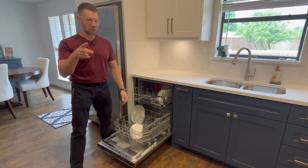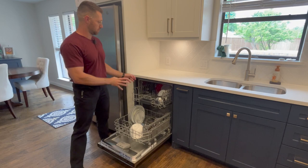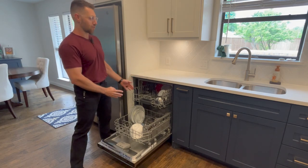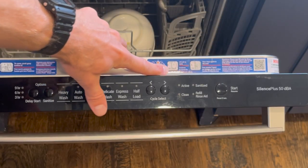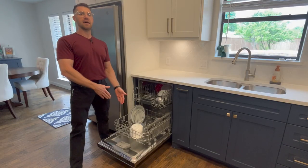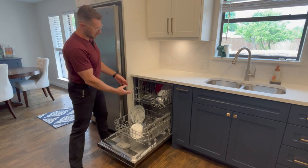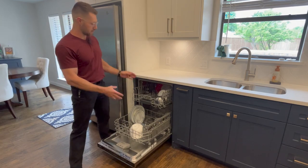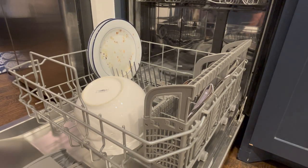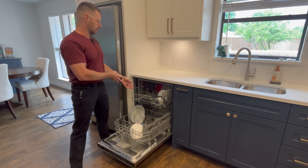There are two reasons. Number one, you save a lot of water because these dishwashers are designed to use just a few gallons per cycle and clean the dishes thoroughly. Number two, the soap that you put in here needs something to attach to. So if your dish is extremely clean and the soap comes up and hits the dish, it just rolls right off. If it has a little bit of dirt on it, the soap will attach to the food, the dirt, the chunks — and it will do much more in the cleaning.